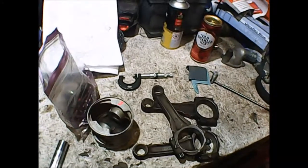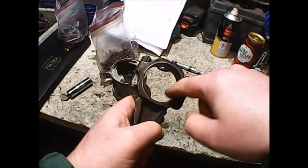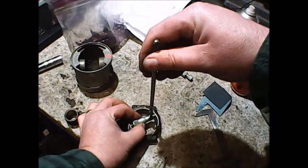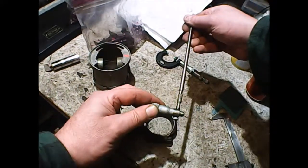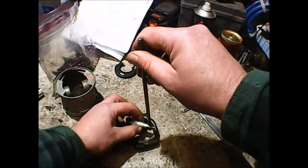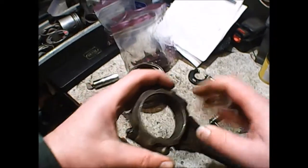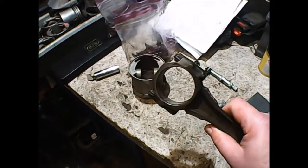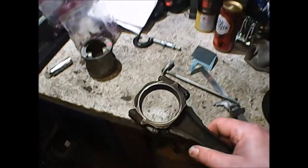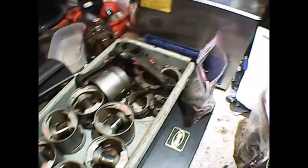The next thing I was doing was checking the big end hole that the bearings go into, making sure it's not oval. To do that I'm using a very simple bore gauge. I stick one end in and pivot until it just reaches a tight spot, then measure it across multiple axes. Whatever axis I'm going across this hole is exactly the same measurement, so it's round. Obviously, if the engine has been running tight and the bearings have all shot and the engine's been overheated, I want to make sure these con rods are in good shape. Every single one of these con rods is spot on, as are all of the gudgeon pins.